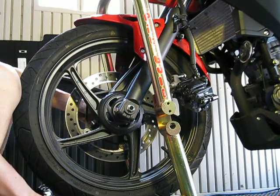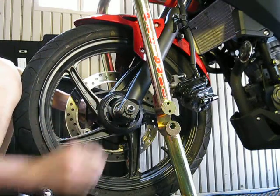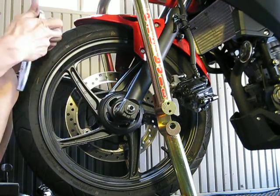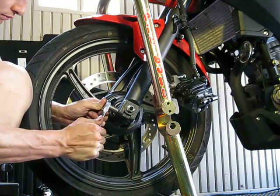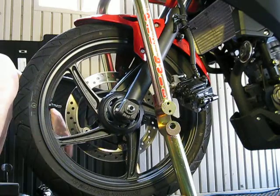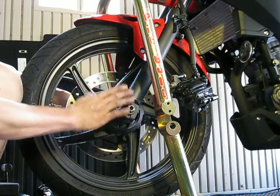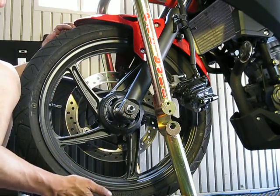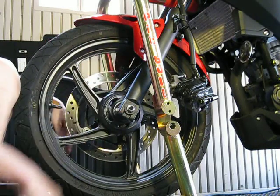I'm not going to do that — I think I'm okay where I'm at. Now we tighten this up. This is a 12mm. That's it, so that's the front wheel. The main thing is just getting it lined up with the axle over here. Make sure you're not squeezing the legs together or apart — let it fall where it is and that should be good. And like I said, if you're not sure, get it back on the front wheel and compress the fork a few times with the pinch bolt loose, and this will kind of re-align itself. And you'll be good. That's it.